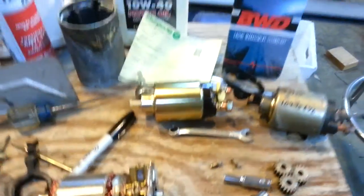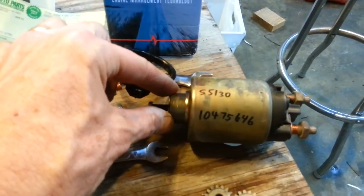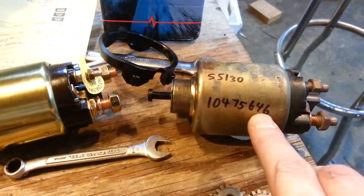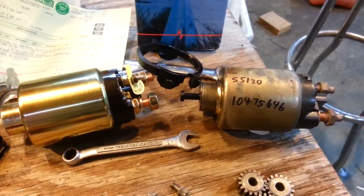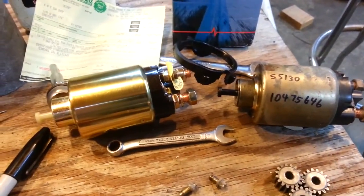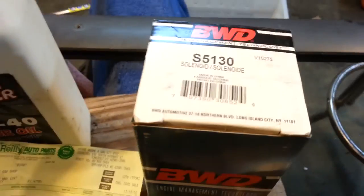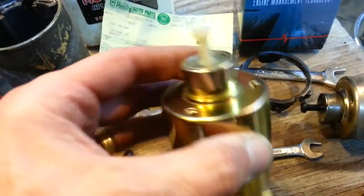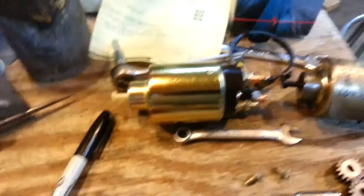I decided to go ahead and take this all apart and clean everything up real good. Here's the original OEM solenoid from 2005, what came on the RV. I looked up the AC Delco number but couldn't find any locally. During some searching I was finding solenoids anywhere from $13 to $50. I want a good solenoid — I don't want to put a $13 solenoid on my motorhome. At O'Reilly's I found part number S5130, actually manufactured by Borg Warner — that's what the BW stands for. It is made in China, but just look at the finish — it looks like a very high-quality part, good and heavy, looks virtually identical. It was $45.83 with a lifetime warranty.